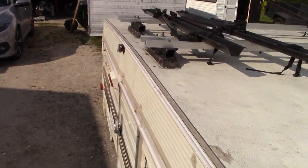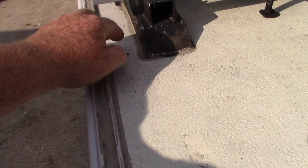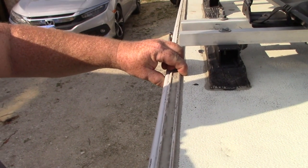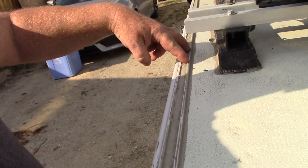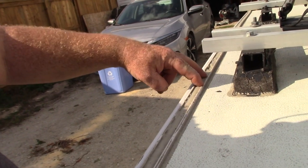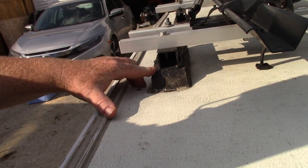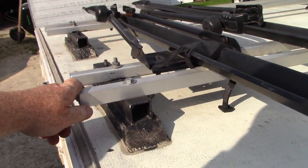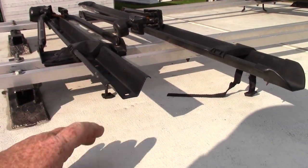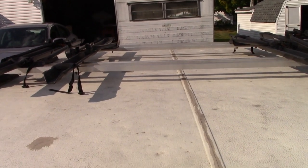This one has a roof rack that one of the original owners made and attached to the roof. Most of them attach right about here and they bolt in, but that board is very thin and weak — sometimes water can get in there, it rots out, and your roof rack can come off. There are specially made roof racks for these, but this was a homemade job. I used some aluminum bars across it but the aluminum was too weak so I had to double it up. On top I have four bike carriers close together — one bike one way, one the other — and space in the middle for a kayak or paddleboard.